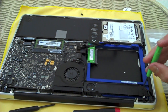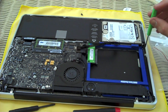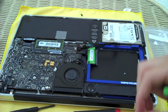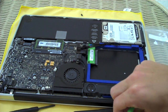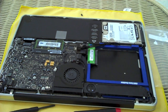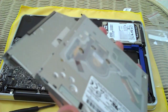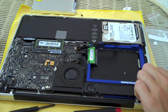I just went ahead and put all the screws back in that I took out — the two on the speaker module and the one right here. I had to use the two longer ones from the bag. There were two very large screws I don't know what machine those are for, and then four screws just slightly bigger than the ones that went in before. Since the Data Doubler is thicker than the DVD drive module, you need some longer screws to get through it.